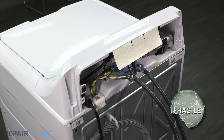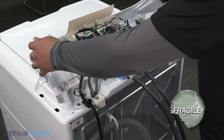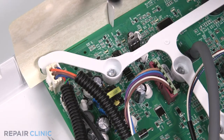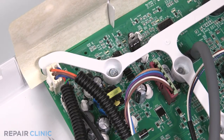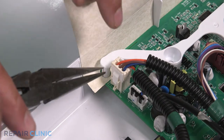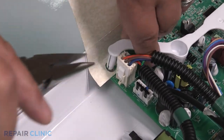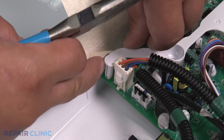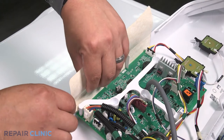Pull the panel out from the bottom and slide it to the right to free it from the backsplash. Slide the backsplash back and tilt forward. Loosen the screw closest to the peg that is holding the shield in place. Squeeze the peg and lift it out to remove the shield. Note how the shield is placed in the backsplash and peel it off.